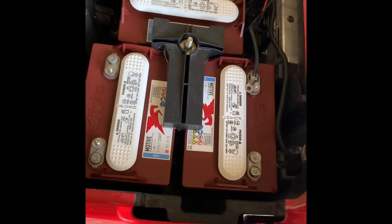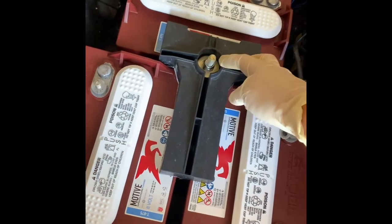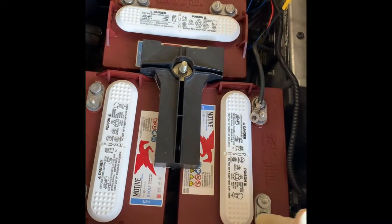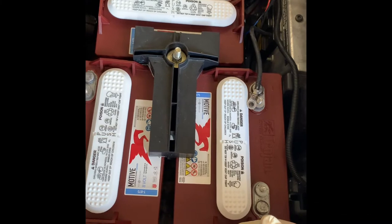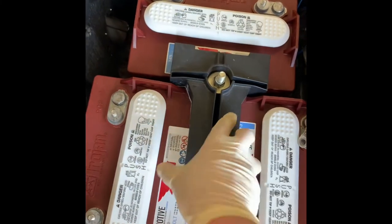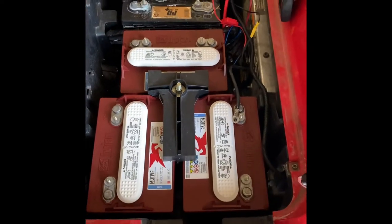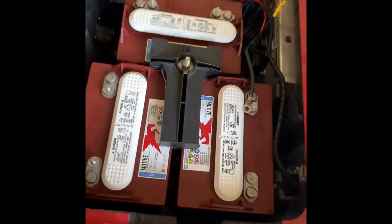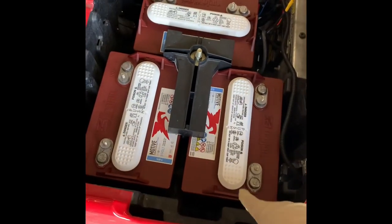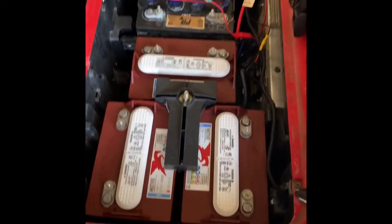Dropped in the three new batteries. I had to go from the bottom to push the tie rod up so I can get some thread on it, and then you want to make sure it's hooked underneath — it hooks into a metal bar down there and then you just tighten it down. You want to make sure this thing is tightened down so your batteries cannot come out in case the cart flips over. Now that they're all in on this side, as you can see all the terminals are still facing away from each other. So this side is done and I'm going to go ahead and get the other side done.